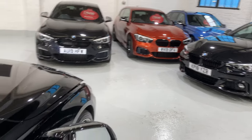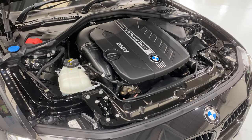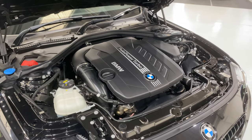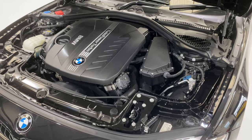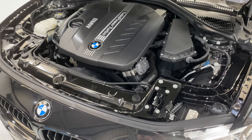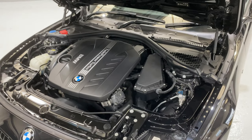Let's pop the bonnet — two pulls — and now we can just lift the bonnet. So this is our three litre twin power turbo. Essentially what that is, is a twin scroll turbo — there are two inlets into the turbo, split from the six cylinders, so half of them go in one side and half in the other. It's all done according to the timing of the explosion from the cylinder to create a faster flow through the turbo. The idea of a turbo is to speed up the airflow into the engine, and it helps with reducing lag — better for economy and much more efficient.